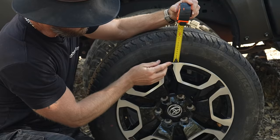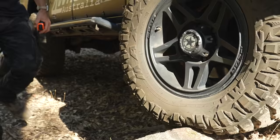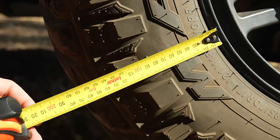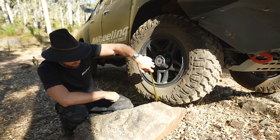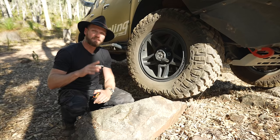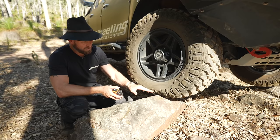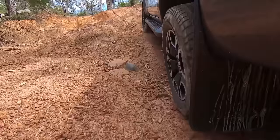If I put this tape here to the top of the rim, we've got 120mm. Check this out — this is a much bigger tyre and as you can see it's resting on a rock. Its sidewall is about 180mm, but we're resting on a rock at full highway tyre pressure and we're at 120mm — the same measurement we're getting from that stock tyre. So you can kind of see already where I'm going with this: if this is a fully inflated tyre resting on a rock and it's already bulging to 120mm in the sidewall, what do you think that other one's going to do?